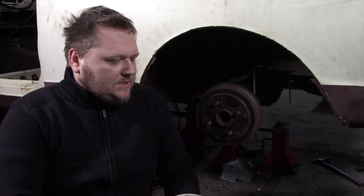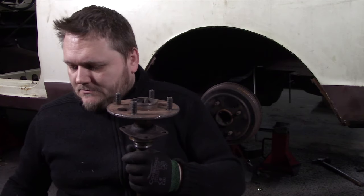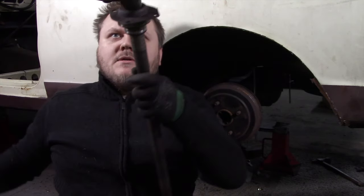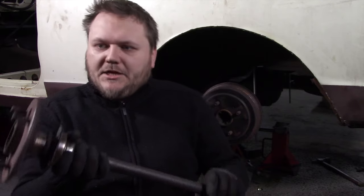It definitely isn't going to be a bolt-on solution. The problem is the axle, this is a KE30 axle. As you can see, it isn't going to fit. The problem is this ridge that's sitting right here. It has to come off. So it is not going to be bolt-on. This is a KE10, but it's a KE30 axle. If there is really a demand for it, then I want to make it for the KE10 also. It should not be that complicated to do.